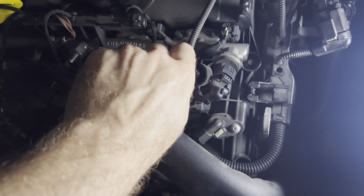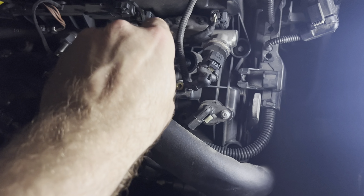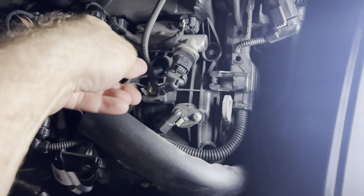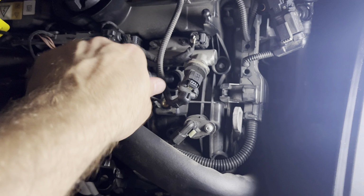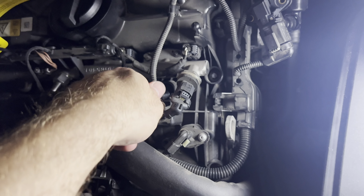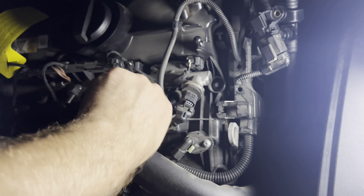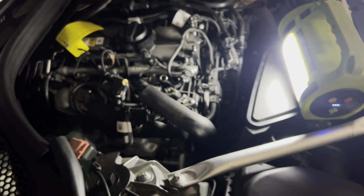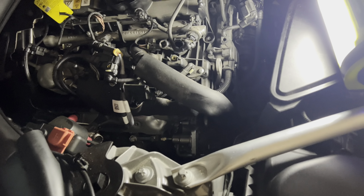Now you go in and tighten only by hand. You don't want to use any tools in the initial process until it's all the way in and you can no longer turn it by hand. I didn't put any anti-seize or anything of that sort. I don't think it's needed for these aluminum alloy engines, maybe for different types of engines. Okay, so now we reach all the way. I usually hand tighten, but if you use a torque wrench, you can look up the torque for tightening the spark plug, but I do it by hand.